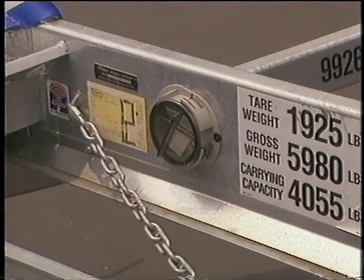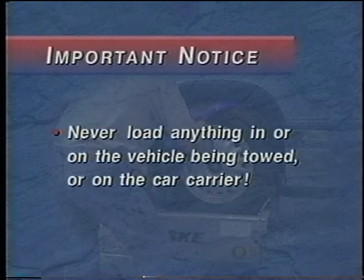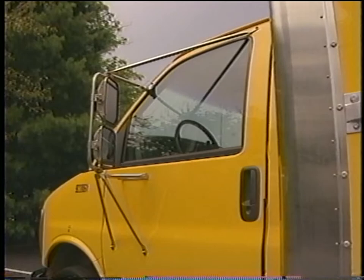If you require the carrier's registration while traveling, you'll find it on the front inside frame rail in the document holder. Please do not attempt to back up the truck with the car carrier attached if you are not familiar with backing up a trailer — this could result in serious damage to your car, the truck, and car carrier due to jackknifing. Never load your car or tie to the car carrier any household goods or other items, as this will create an overload situation that could cause a failure of the car carrier during your trip. Repeat the safety check after 5 miles and then each 50 miles thereafter, as components of the car carrier may loosen during travel.